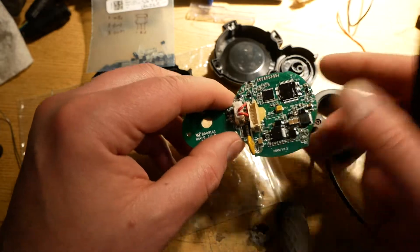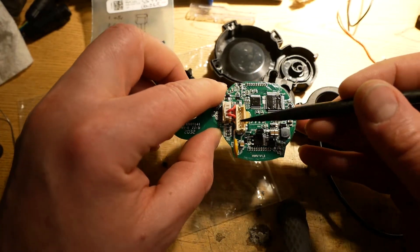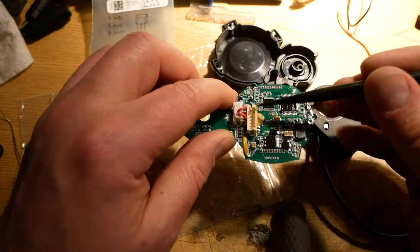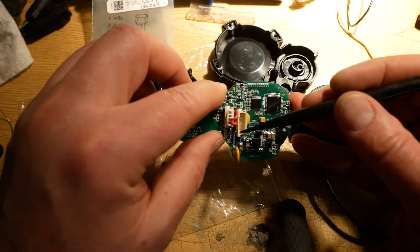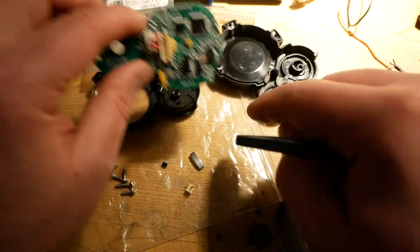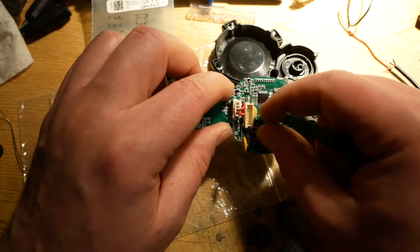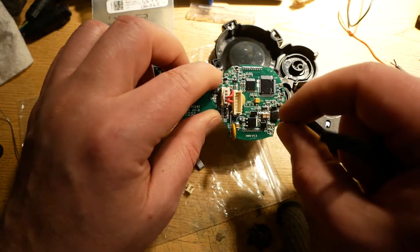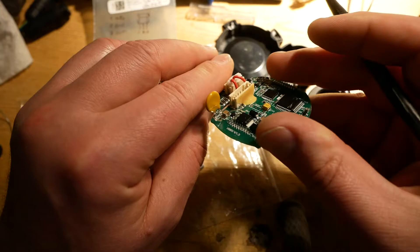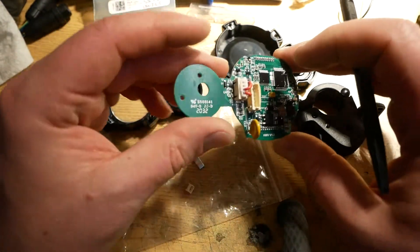There's one other detail: this JST male connector is the signal cable that goes down to the controller and the rest of the EV — for enable and all that stuff. When you take the throttle off your Dualtron scooter, take the back cover off and you'll see the connector. Pull that out by the connector, not by the wires, because you might break them off. It may be secured by a silastic, so just pull it out and then you'll have the whole thing free in your hands to work on as you wish.